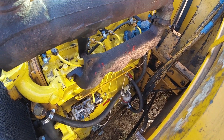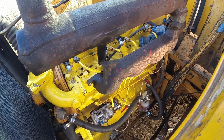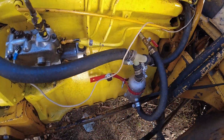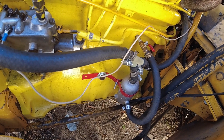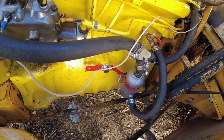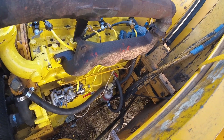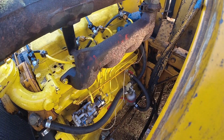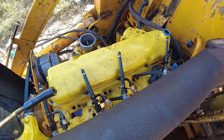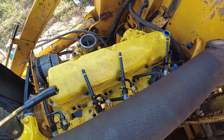We bled all the fuel lines on the other side. There's a fuel filter with a bleeder valve on top — we opened that up and pumped the lever inside the injection pump to get the filter bled out. Then we loosened the line on the back of the injection pump and continued pumping the fuel pump lever, and we got fuel coming out. We cranked the engine over with all the injector lines loosened and they were all pulsing out fuel — though why they weren't pulsing at first, I do not know.